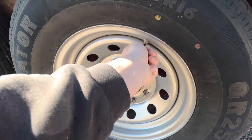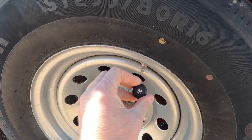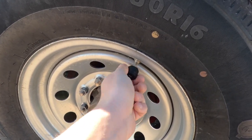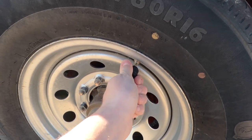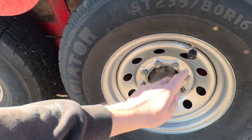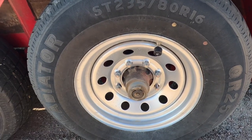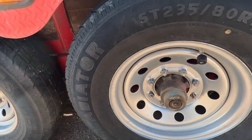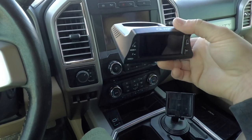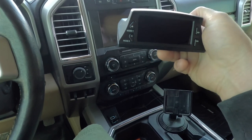This is a pretty simple step. All you do is remove your factory valve stem and replace it with the correct TPMS sensor — this one is the right front. I now have all the TPMS sensors on all four wheels. I'm going to install the controller into the truck, then connect everything wirelessly and make sure all tire pressures are correct. Just pulled the controller out of the packaging, and before you fire it up you want to charge it with a DC-to-DC adapter.